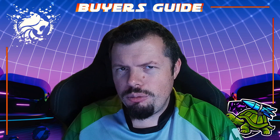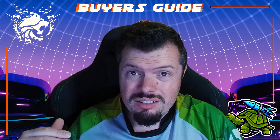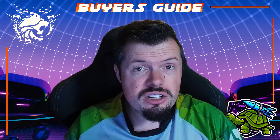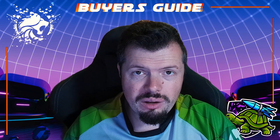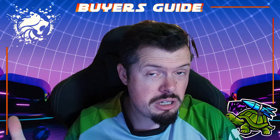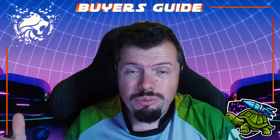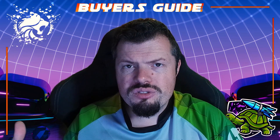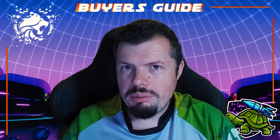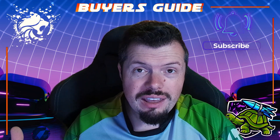This was my Intel B580 buyers guide. If you pair the B580 with a very entry-level CPU like a Ryzen 5 5500 or similar, you're really not going to get the full potential of the B580. In that instance you'd honestly be better off going with an RX 7600 or RTX 4060, because they don't suffer as much performance loss on those platforms and the value balances out. The B580 is really nice for its 12GB of video memory, and as Intel improves their codecs — hopefully with AV1 encoding for streaming in the near future — it becomes a no-brainer as one of the cheapest ways to go about that.